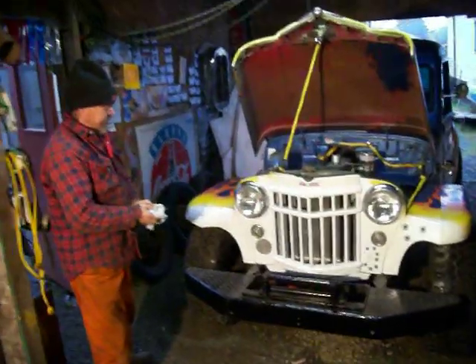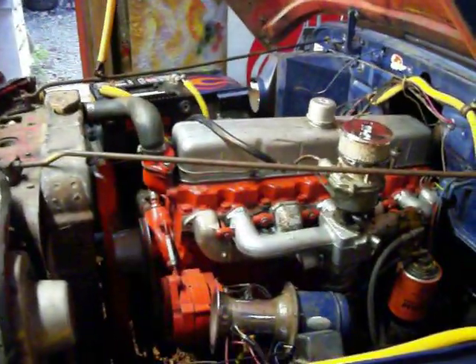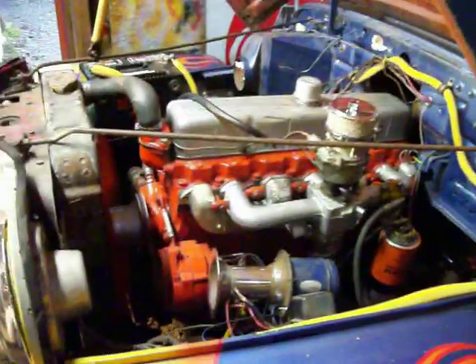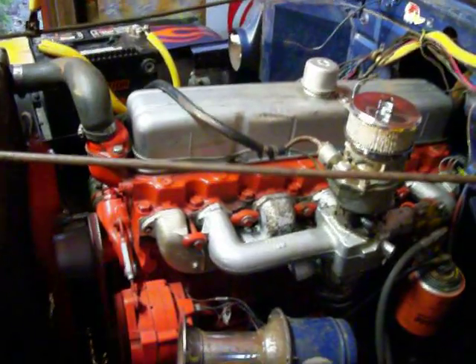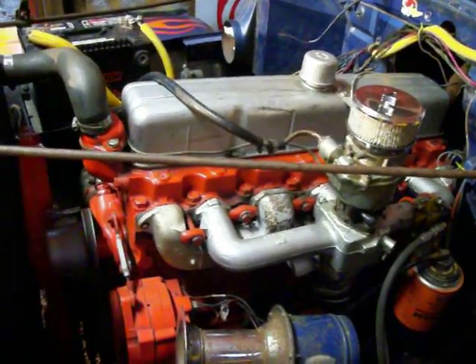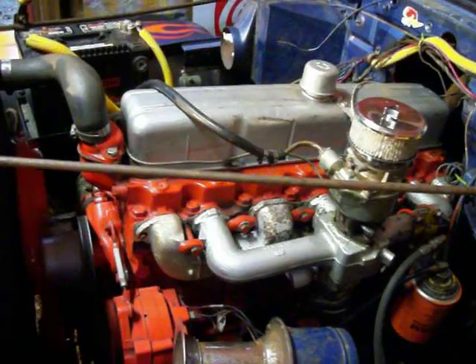I'm going to put some water in there. You got enough water to back it out a couple of times? Okay, the starter's been pulled out. Turns out to be ignition problems with the wire — we changed the wire and this is what we got. Solenoid wire. The wire to the solenoid was bad.